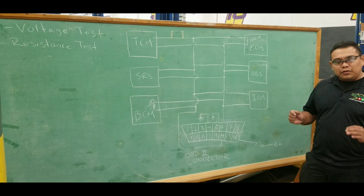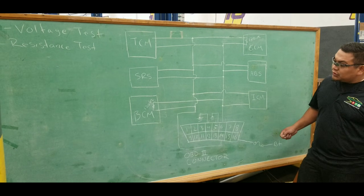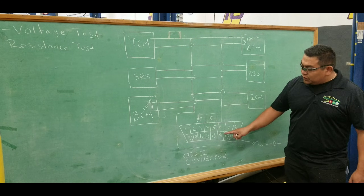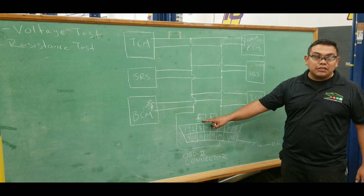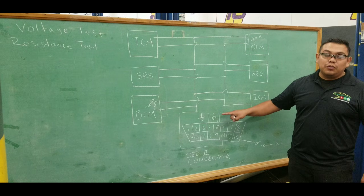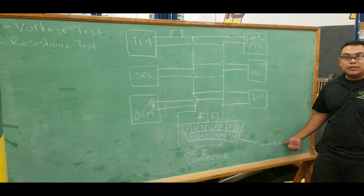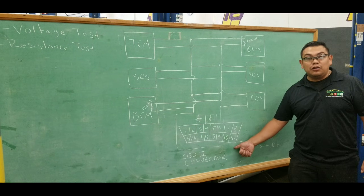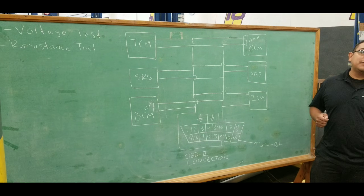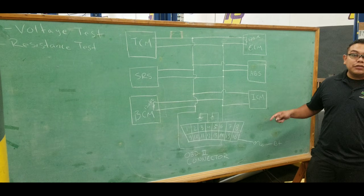You should be very close to 60 ohms, plus or minus one or two ohms. One of the first tests you can do is check terminals 4 and 5 on the OBD2 connector — they have a ground, which could be a chassis ground or a battery ground. Terminal 16 should have battery voltage at all times, supplied through a fuse to the OBD2 connector terminal 16.